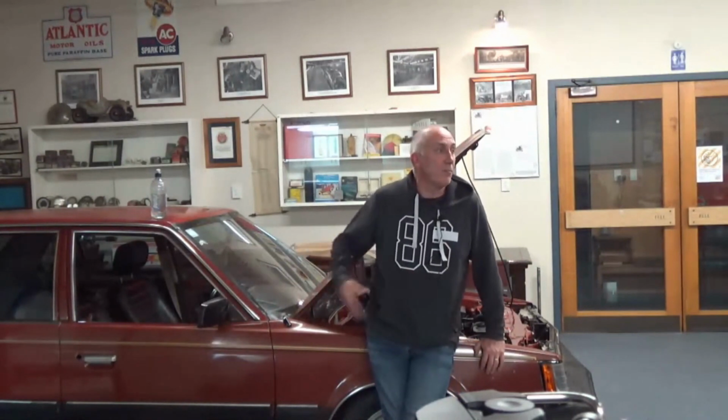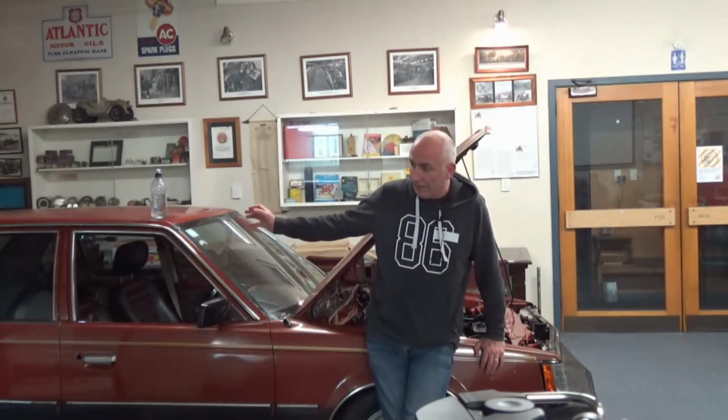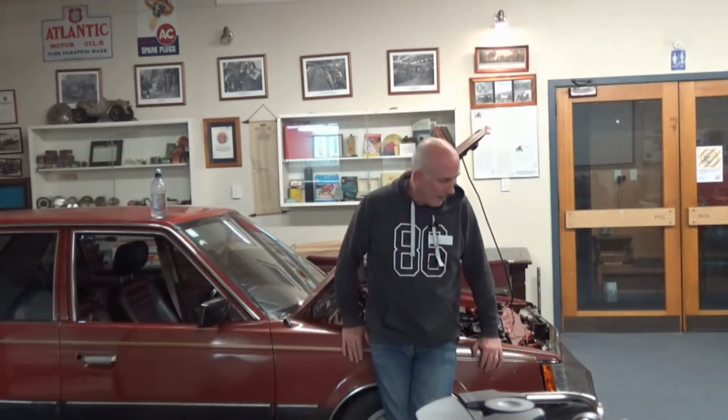It's got the factory fuel lines and brake lines through it, and with the 6-speed gearbox, where the gear lever is, pardon me, it's really close to the brake and fuel lines, but really close. There's about 10 mil clearance, and there's an element of I can't actually see how it's going to contact it. But if I was doing this as a scratch build, I wouldn't put the lines where they are. I'd put them a little bit further away. So is that actually an issue or not? We'll find that out.